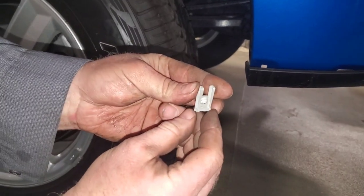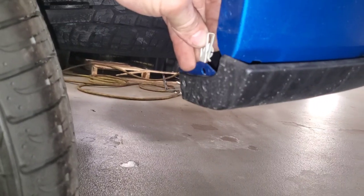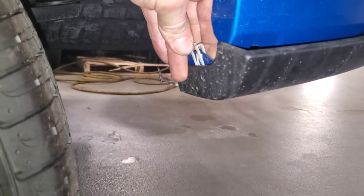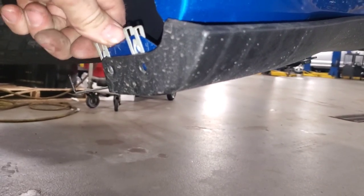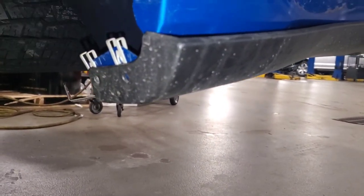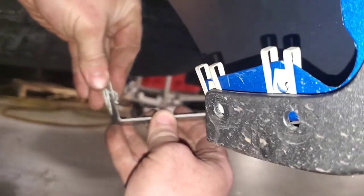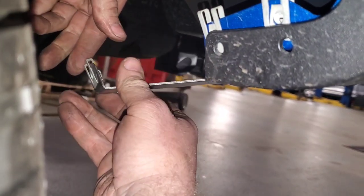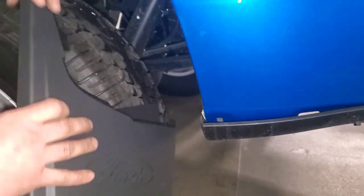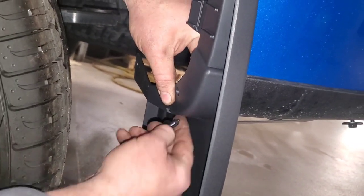Then you'll take your mud flap. Take these clips and put them flat side towards the work — inside here. This clip is going to go here, and you want to make sure it's centered over the hole. This clip is going to go here. Then on the other end of the bar you're going to put that last clip — flat side to where it's bolting. Take your flap and put it up here, push all this back, and take that plastic push clip and push it in. There's a hole right here that it goes into.